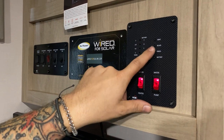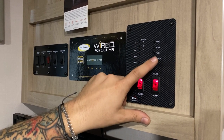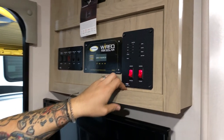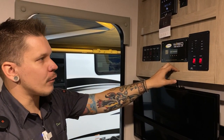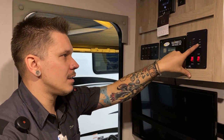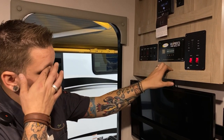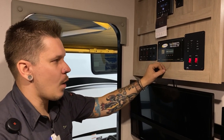Beside that we have your courtesy panel — convenience center, micro monitor — it goes by many names, but they all let you know how full your battery and holding tanks are. The more light you see, the fuller whatever you're testing is. Battery reads full anytime you're plugged into shore power — to get a true readout, unplug from the wall and then test. Fresh water is full, black water is empty as it should be, gray water is empty. We also have your water pump switch here — that's what we use to draw fresh water up from the holding tank to the fixtures.